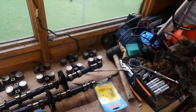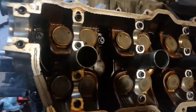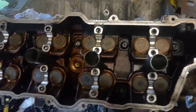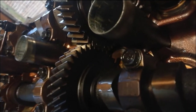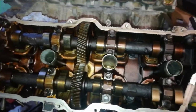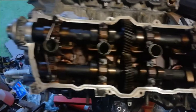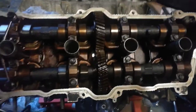We'll just clean the shims up, put them back on in the correct order, and put the cams in — and that is it ready to go. The buckets are reinstalled in the same order they came out. There are two little dots that need to line up when you put them back in. I've just got to put the seal in that end and take that little bolt out — I can't forget that. I just spun the cams so I can access the bolt, take that out, put the seal in over there, and that is this bank done.